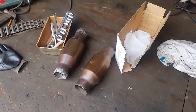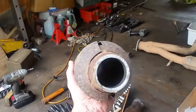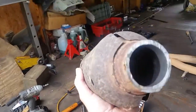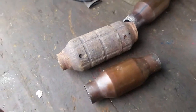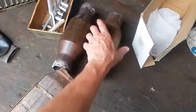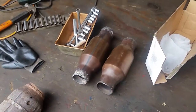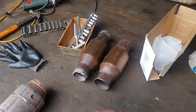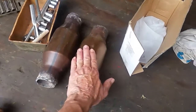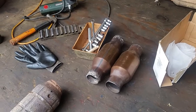The old catalytic converter that was on it is a much beefier one — it's shot, I cut it off. I thought I could order one like it, no problem. But you have to be careful, because a lot of times these aftermarket ones are not big enough for the emissions system to work properly. In a nutshell, the O2 sensor behind the catalytic converter is not detecting that it's cleaning up the exhaust gases well enough.